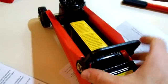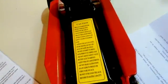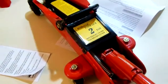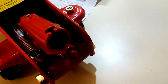And then the jack, which has a handle, which is really nice. It's movable. This is not actually attached to it when you pull it out of the box. You just slip it on there. It's real easy. So here's the lever. You take that, stick end up, slip it into the hole, lock it either left to right, whatever you're more comfortable with, and then all you do is pump it up. But before you can actually do that, you have to tighten this right here so that way it's closed.